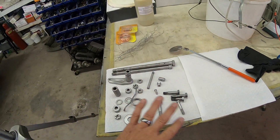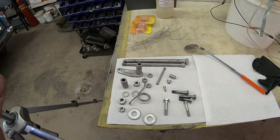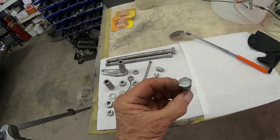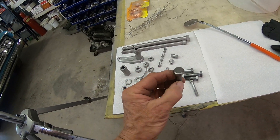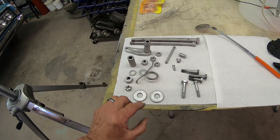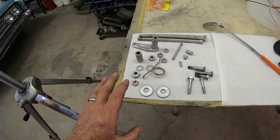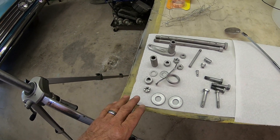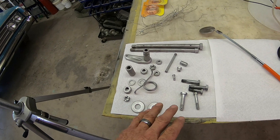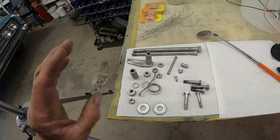The first thing you need to do is gather the parts you're going to plate and sandblast them. If you want the part to be shiny, like this bolt, you need to wire brush it or buff it with a Scotch-Brite wheel or something to bring out the shininess before you plate it. Otherwise it's going to be a dull cadmium finish. Really what we're looking for, for the most part, is just the rust and corrosion preventative that you get from the cadmium parts, but you want nice appearance too. So if you want things shiny, make them shiny.